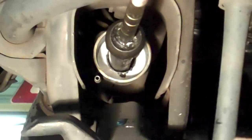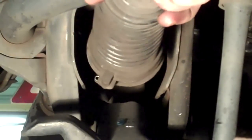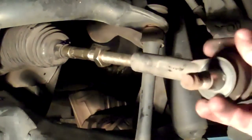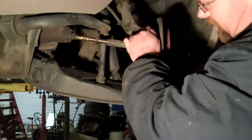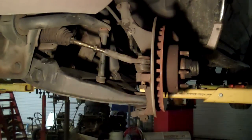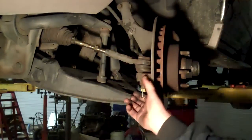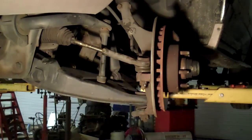There's a vent tube on the bottom of the rack and pinion — it has to be aligned with the hole in the bellows boot. Once you've got your zip tie and your outer clamp in place, you can reinstall the jam nut and attach the outer tie rod. Count the revolutions again and do the same number of turns. Reconnect the outer tie rod into the steering knuckle, reinstall the nut, install a new cotter pin, and snug the jam nut. Reinstall the wheel, then you're ready for an alignment.